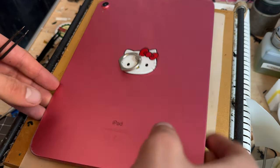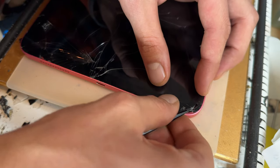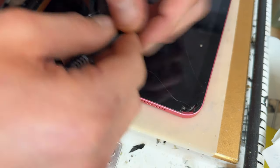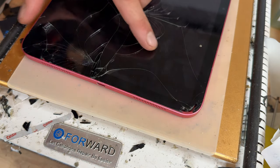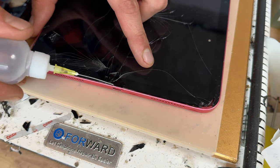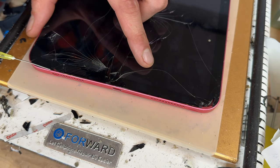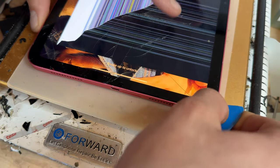Once the iPad's had five minutes on the heat mat I'm going to flip it back over. This one's going to be awkward because it's got this little ring thing on it and I don't want to remove that. I'm going to start off where I can see some of the adhesive and begin by trying to pull out as much adhesive as I can, which of course instantly snaps, so we'll go to plan B: apply some isopropyl alcohol to the edge of the iPad so it's soaking into the gap between the screen and the digitizer.